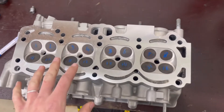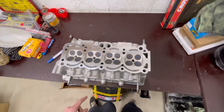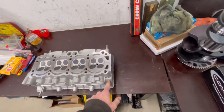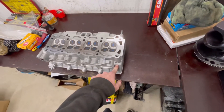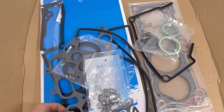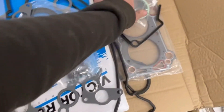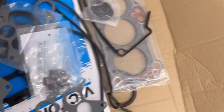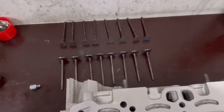I've got these on a knob, I'm going to pull them out so we can start prepping. The head had to be drilled — pretty sure it's on this side about here, should be drilled about there. This is the seal kit we've got, it's just sitting on top of the motor at the moment. I'm not going to be using any of these or the head gasket. I might use these main seals but they look a bit rough, so I'll see what Max thinks on those. These are new valve stem seals — obviously when they serviced the head they would have taken all that off. So you've got valve stem seals, valves are all laid out here, all numbered.